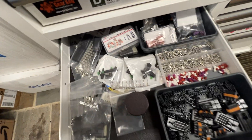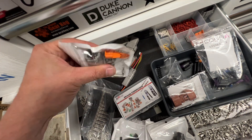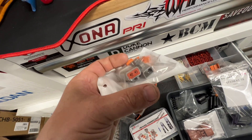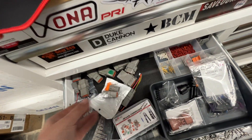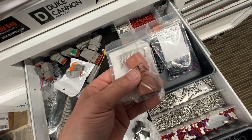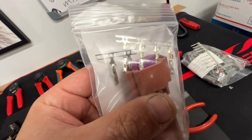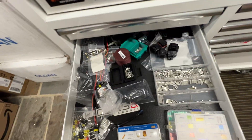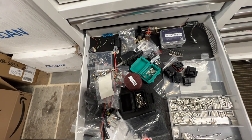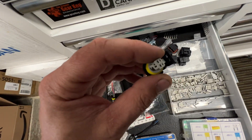You can see how big the DTP pins are — great for fans and fuel pumps, you can get four-pin versions. These are flex fuel connectors, and you'd use the mini crimpers for those because the pins are much smaller.